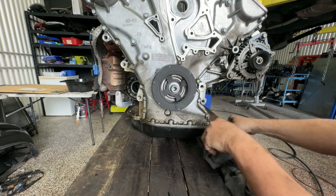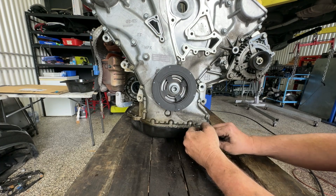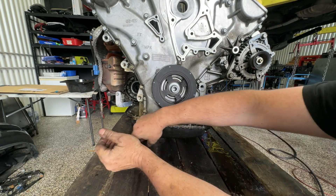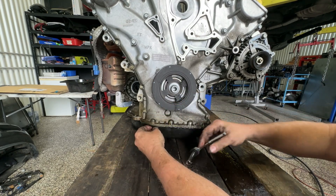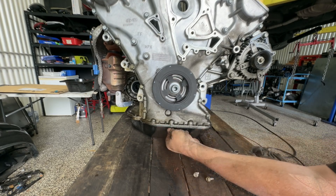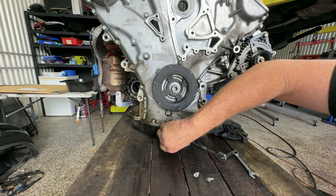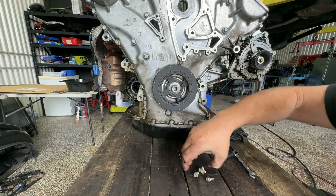It's pretty oily on the sump here — it looks like we're going to have to do a sump seal as well. Just up in underneath here there are four little 10 mil bolts that secure the sump onto this end of the timing cover. These would have been really easy to get out while the engine was still lifted up, but these have been a little bit annoying to get out because of poor access. Note to self in future: undo these before I put the engine on the table.